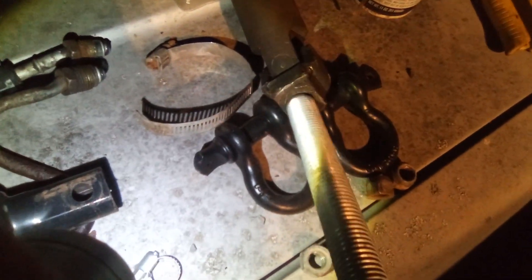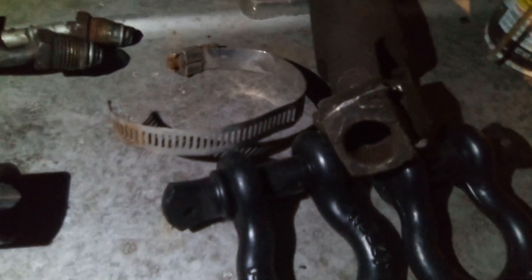If it's a three-quarter, yes, cool. Tomorrow morning I'm going to Krause's. I'm gonna pick up the three-quarter inch tap, and I'm gonna tap this and thread this hole, because it's way big enough, plenty big enough. Then I'm going to thread that into it, and this rides up on that. That's gonna be about a five-inch long shaft extension in between there and there. This rides up on that and then rides back down. This shoves onto the steering gearbox. This shoves up into the column first.